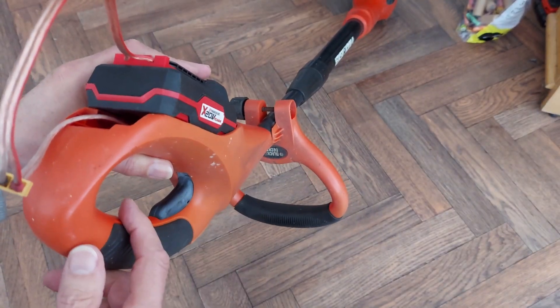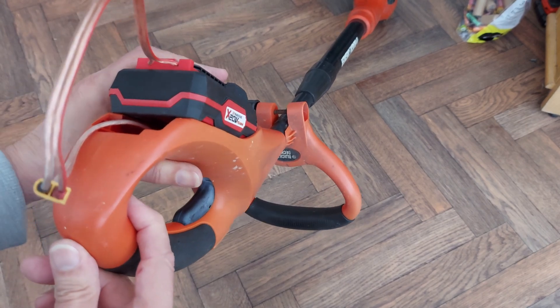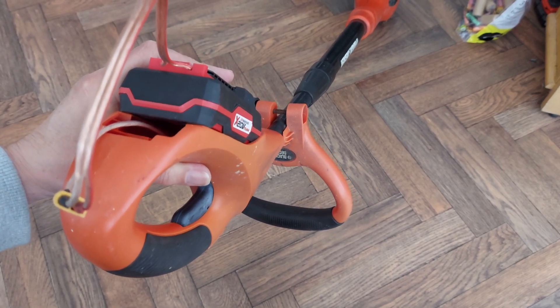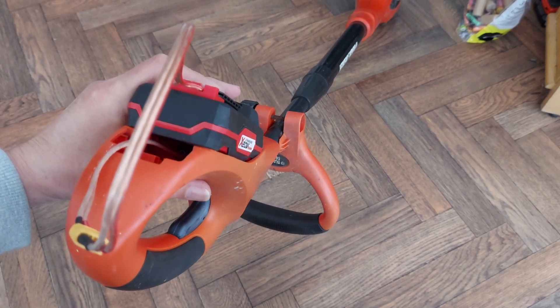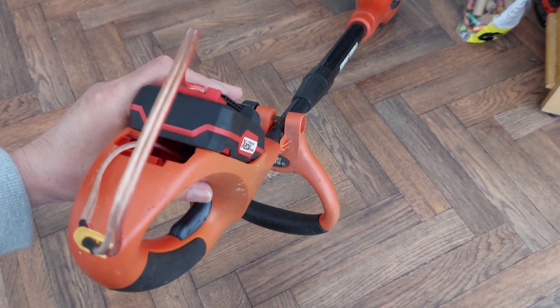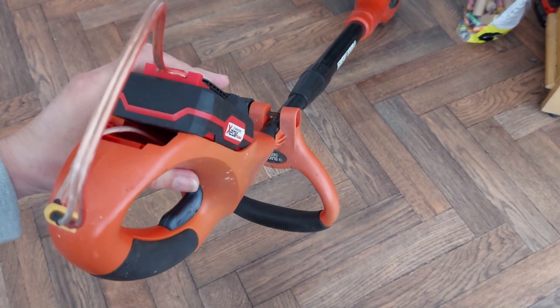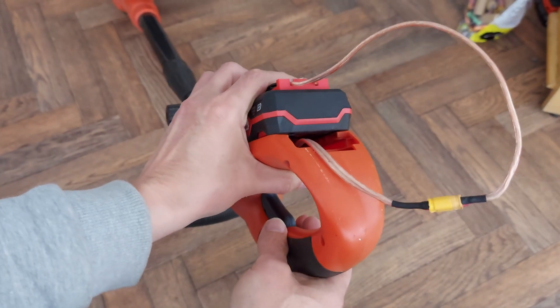You can probably hear that is working. That battery says it's 20 volts — the original was 18 volts — both of them would show more when fully charged anyway. I think this one's got about 21 or 22 volts in it. But yeah, that clearly works, and you could just put a cable tie around there and that'll be job done. So that's the simple fix.